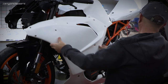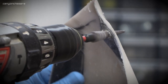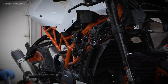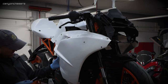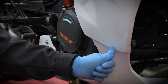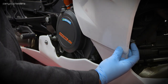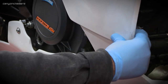Everything kind of needs to be opened up a little bit. That isn't even in the same neighborhood — it's comical how far off that one is. This is probably the result of mixing and matching bodywork. That's a big gap right there. I may put in a well nut to hold that tight, otherwise I think that's a lot of stress to put on that area. The well nut will kind of stabilize it. Honestly, this has been going so smoothly — I'm afraid that this upper fairing is probably where the pain's going to be.